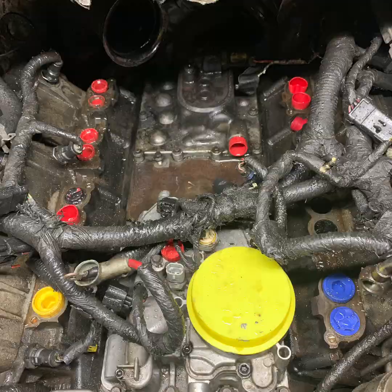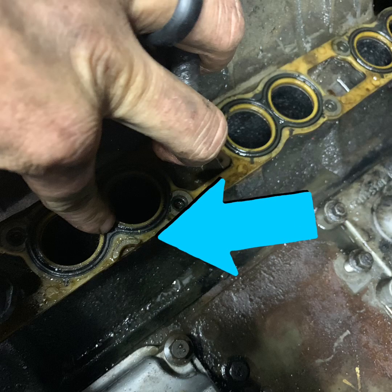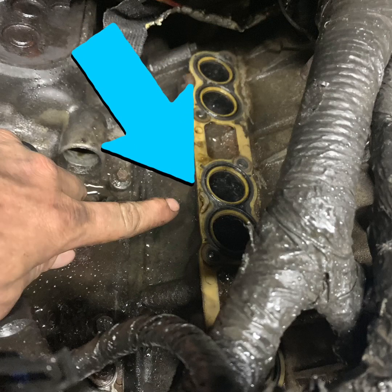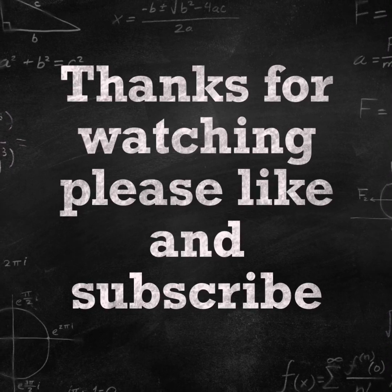Here's the aftermath after we sprayed it out. That little thing does a pretty good job. Now you want to make sure you get this O-ring put back in it — that is very crucial. There's coolant that goes through there. I forgot one time on the very first one I ever did and I'll never forget it again because it's a pain to tear everything back apart. Also, right here is the raised part in the intake gasket — you want to make sure those are facing towards the inside of the engine, away from the heads, and facing upward. That's the right way to have these gaskets. Now the intake's in. Thanks for watching, please like and subscribe, and stay tuned for the rest of the videos on the install on this truck.